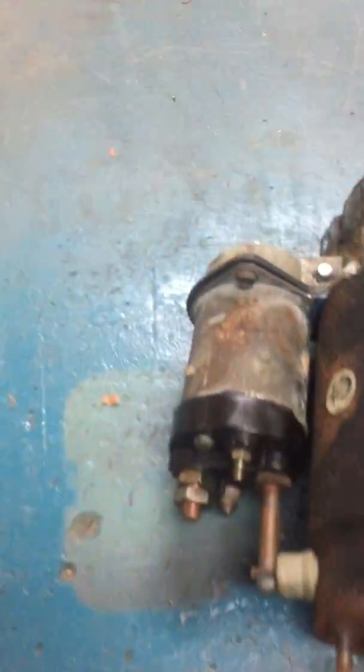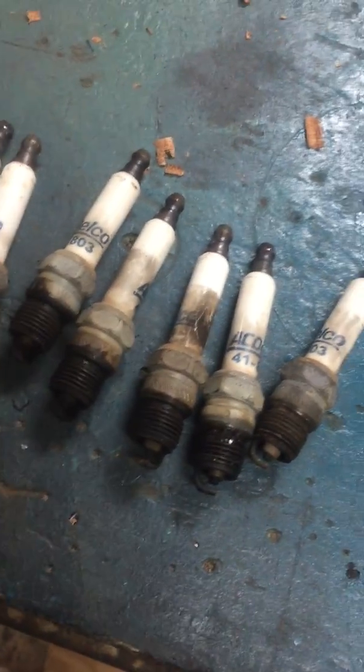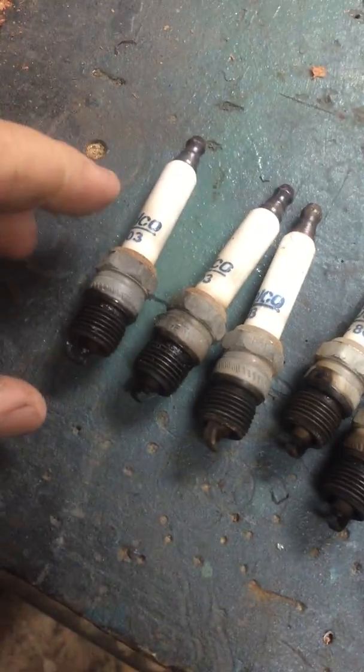It was really kind of goofy for the previous people to have actually done the carpeting first — that was backwards, totally backwards. So we'll be protecting the carpeting with some rosin paper and some cloths like you see here on the fender. We grab these spark plugs and show you one other oddball thing. The spark plugs, as you can see, are quite black. These should be like a charcoal gray color if they're being operated with a proper mixture.